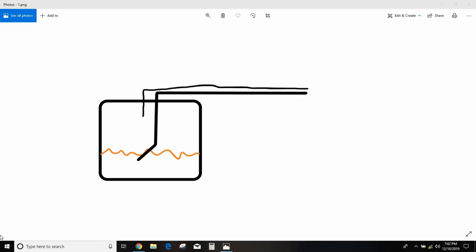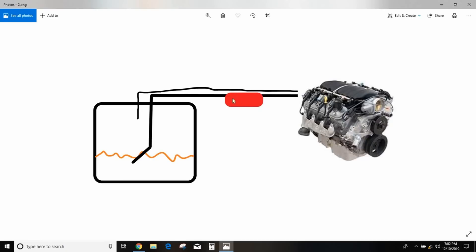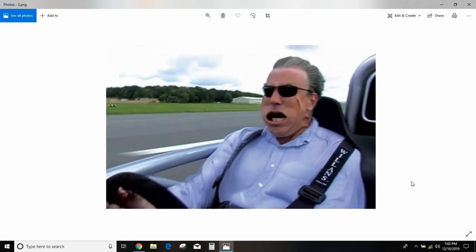So I get the logic — this is your stock tank setup here on the screen, poorly illustrated. You have a vent line, possibly a return line on an old carb setup, and a pickup inside. Your fuel level floats around and you think, 'I'll just jam an inline fuel pump in there and it'll be awesome, because that'll be so easy. I can use my vent line or return line if I have one, and everything will be great.'